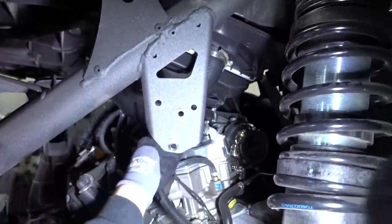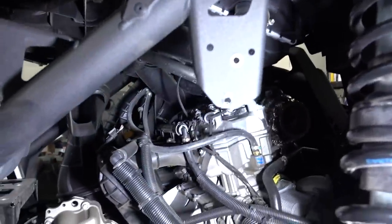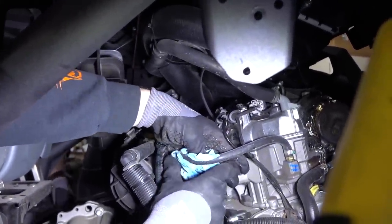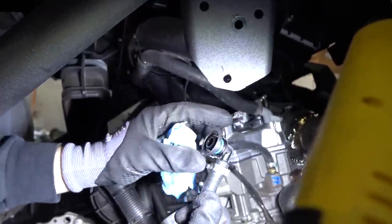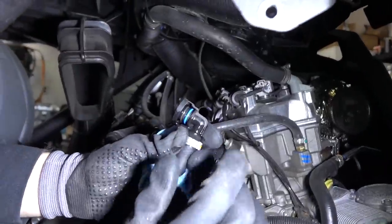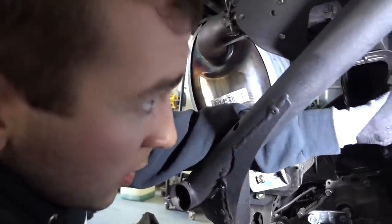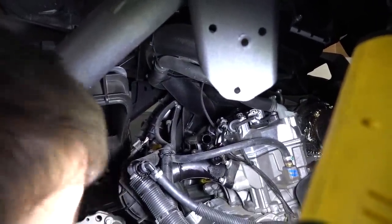The 2019 connector looks like it's got a secondary pinch on it — let's take a look. Get a rag first before we get too carried away so we're not spraying gas everywhere. So here's the lock: on the bottom and on the top it locks around this collar on your fuel rail. You squeeze the sides — that lifts the top and bottom up and you pull it out. Be prepared for some gas to leak out, so good idea to have a rag. Don't have someone try to start it while you're doing this — bad idea. There are two T-30s holding the fuel rail on that you'll need to remove.